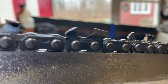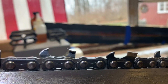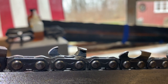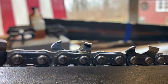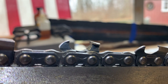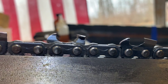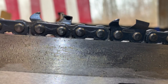That's the side, and then you go down to one of the teeth here and you can kind of see as well. See there? See how that kind of has a hexagon shape, or like a V instead of a round, it's close to square. I mean, it is square. It is square filing, but it's going to be a lot like that Stihl HEXA when it comes out. And hopefully y'all can see that pretty well there. Yeah, there's a good angle. See how that is?